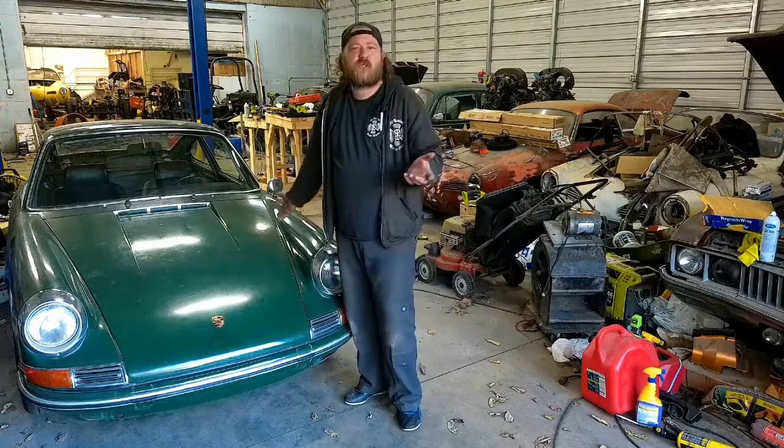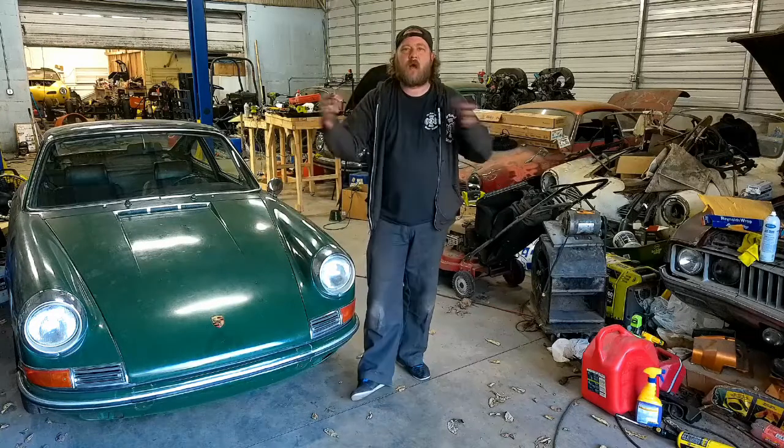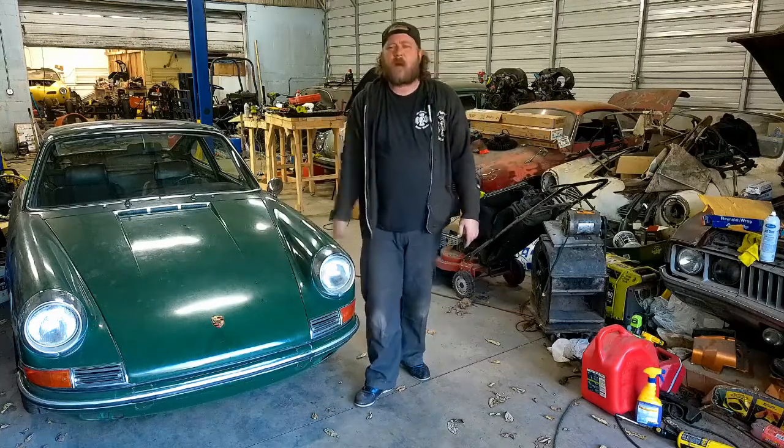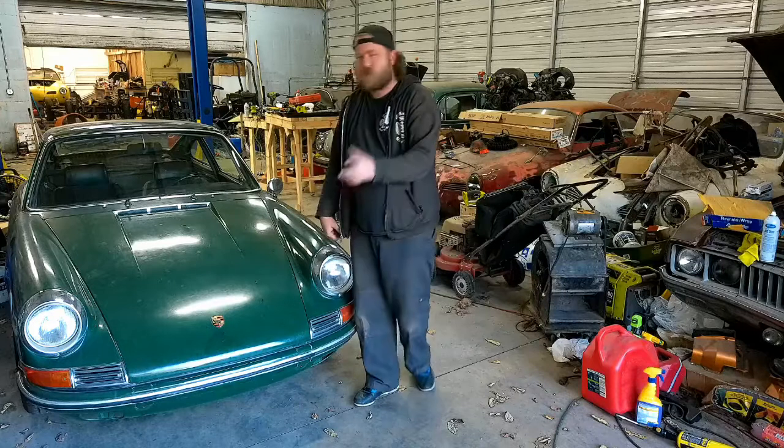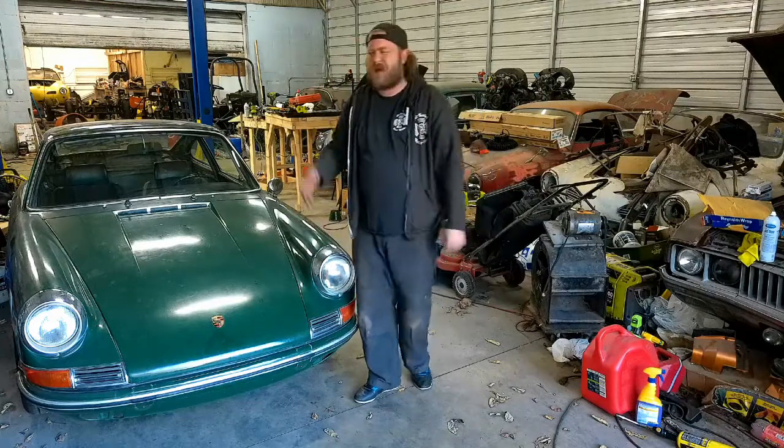Alright guys, 912, we're back at the shop. She drove well, did my normal 20 mile-ish loop on it. Kept that at a higher RPM and lower gears, just because, like I think I've said this many times, I do city driving. I wanted to perform in the city. Highway, they usually are fine, but I keep them in a higher gear. Number one, I want to rag out that engine, and because I have that cheapy fuel pressure regulator in here, I want to make sure that it's not going to drain the old float bowls. So when it is at a higher RPM is kind of what I'm getting at.